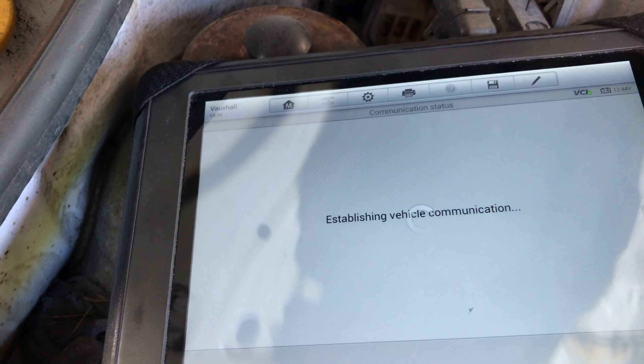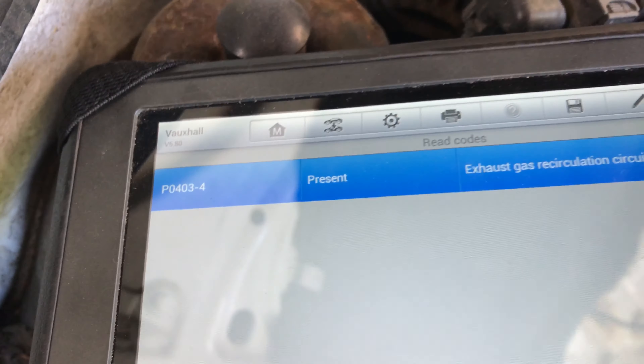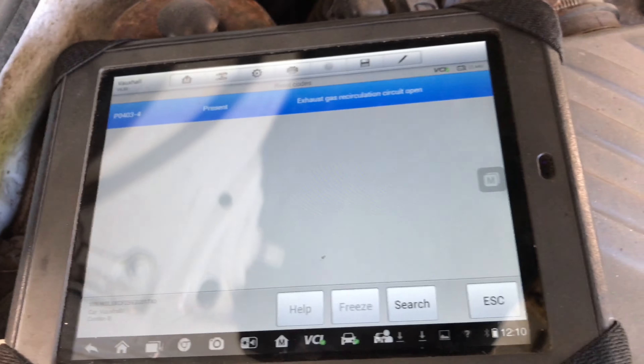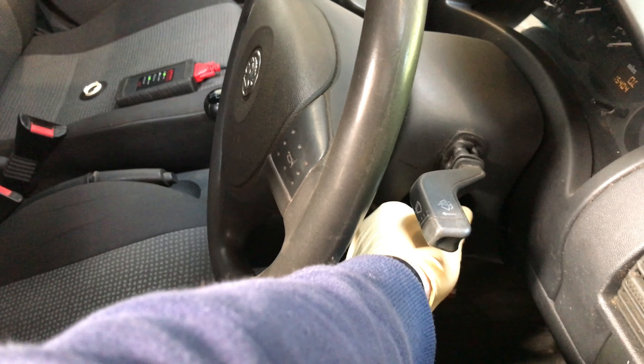There was other codes in this as well — I'll put them in the edit. So you can see that EGR valve code, not present. But I'm cranking it over and if you look at the live data, I'm not getting any fuel pressure. I'll let you hear it. That's a crank, so read the codes again.